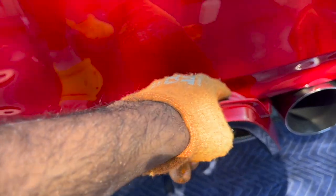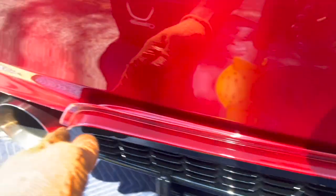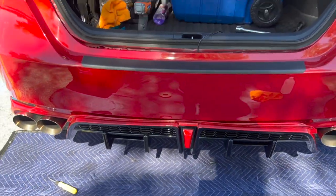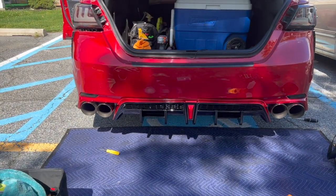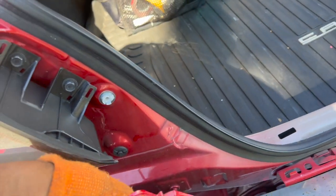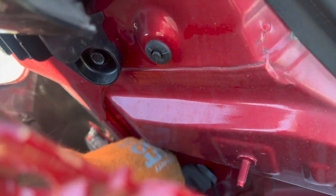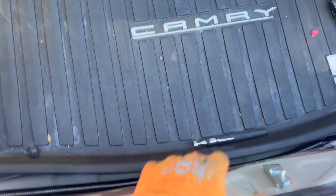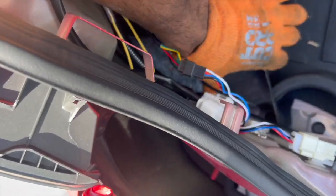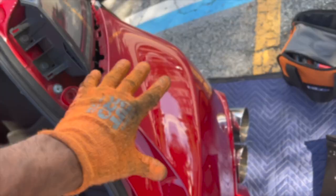That's what you're looking at underneath. Up top, the fitment is way better — you're not relying on this lip, it kind of sits flush with the bumper. I really like the design. Now you see why I paint matched it — from afar it looks like it's part of the bumper. The wire is long enough to stretch all the way over here. Like in my reflector light video, we ran it through this gasket right here — it opens up, run it through, and from the inside take off this panel. Prop it open and the gasket is sitting all the way down here after you get the wire through. Put the gasket back properly and get your rear bumper completely back on.